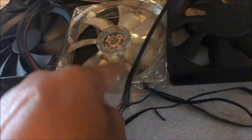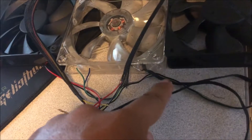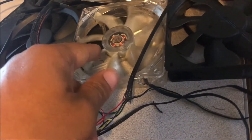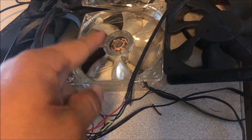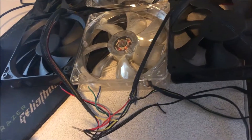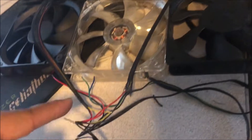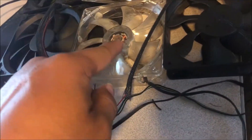This one here is four-pin with black, yellow, green, and blue wires. I also have an LED fan — the black and white strip is for the LED, the middle wire is power, and the other one is ground. So for this one, the white and black wire and the middle wire hook up together to power, and the other one I just ground, so it turns on the LED and gives it power.